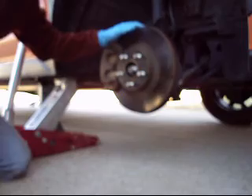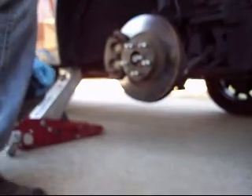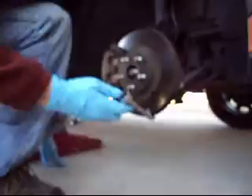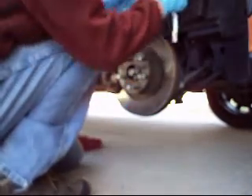Now's a good time to actually place the car in neutral. It's a good time to loosen up the ABS wire and also loosen the brake line and remove it so you have a lot of room to play. You don't want to put too much stress on your brake line or this ABS sensor cable. A 12mm socket wrench will remove those.